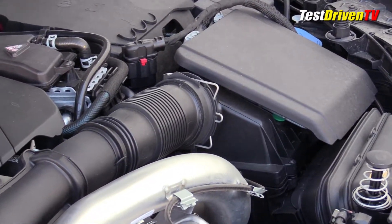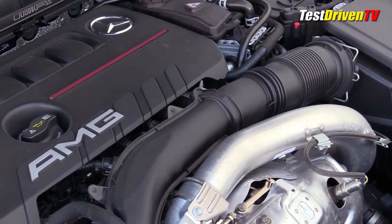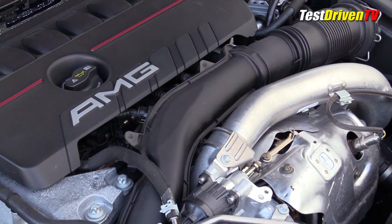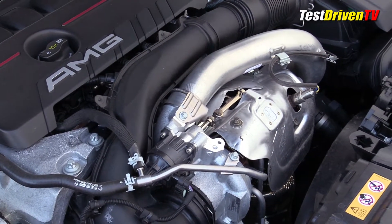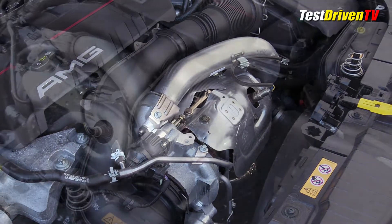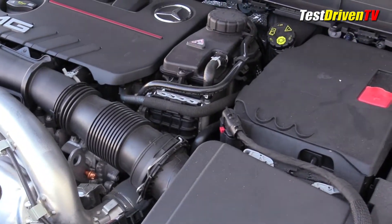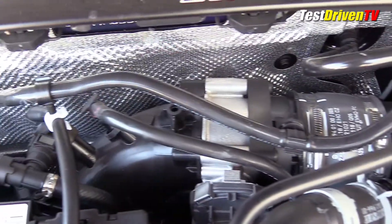Following the airflow, the intake charge starts through a plastic intake snorkel at the top of the grille and into the air filter box on the driver's side of the engine compartment. From there it's drawn into the turbocharger, visible at the top and front of the engine. With the high output variation of the M260, air then travels across to the driver's side of the engine and through an air-to-water intercooler before heading to the throttle body and intake manifold at the rear of the engine.